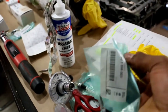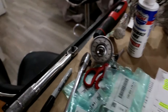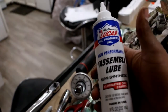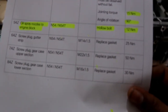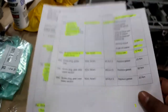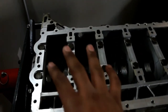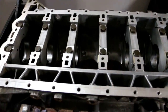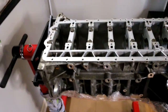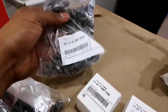The first thing is to reinstall the oil sprayer nozzles — these help lubricate the piston skirts while the pistons are reciprocating. We also have Lucas assembly lube and a torque angle meter, because some torque specs say something like 15 Newton meters then 90 degrees of rotation. All this info is printed from newtis.info. We're going to take off the bed plate and discard the old bolts — the machinist used those to hold the block in the machine. It's very important to replace the bolts.